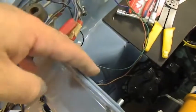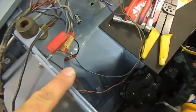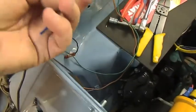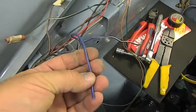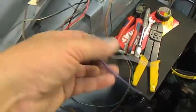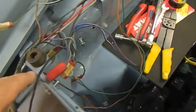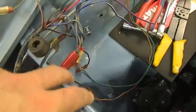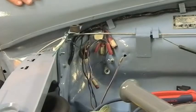So the relays can go here and they can feed the relay or switch the relay coil, and the existing part of it can connect to the relay. Now these cables are at least 10 amps each, so I'm not going to bother running new cables to the other side of the car. I can use those and I can run them off the relays and still use the original connectors, so they'll all look factory, and the only giveaway will be those 2 little boxes there. So I've modified the loom.